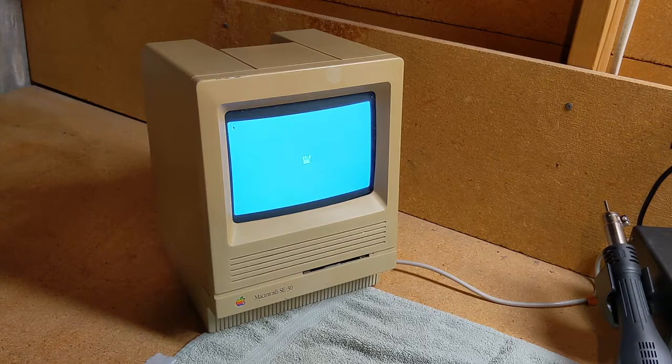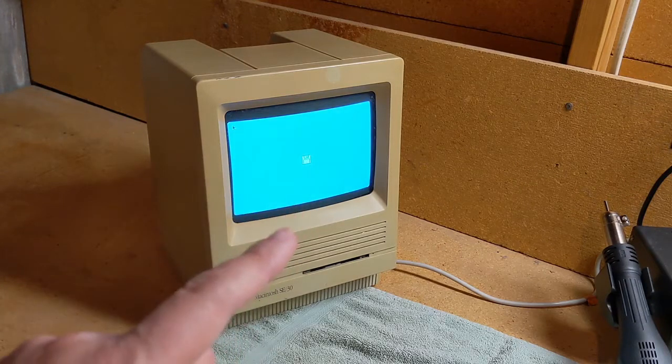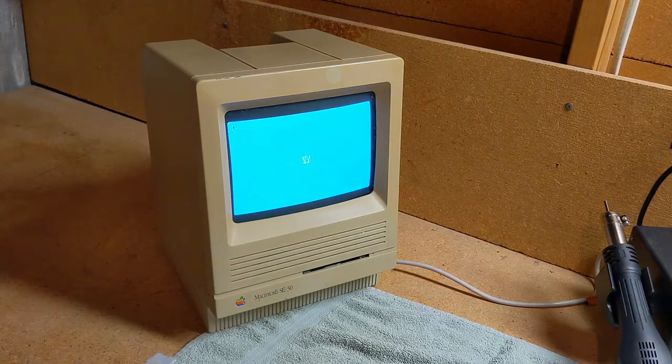The goal for this is going to be: A, get the battery out of it, and B, start pulling the caps off the board. I've got some new capacitors coming and we're going to recap this thing. I'm excited to tear into it. I had to get one of the old Mac crackers, so we'll get this thing cracked open, take a look inside and see how bad it is. These things have batteries on the motherboard notorious for just melting everything around them. But the fact that we've got this far makes me think we can bring this thing back to life.